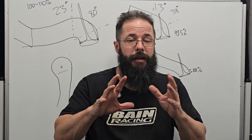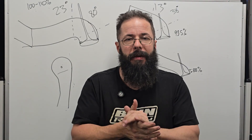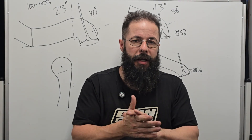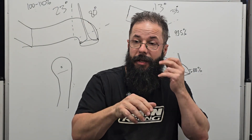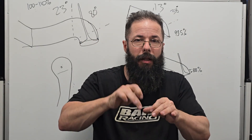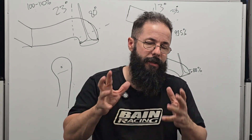In the 2J porting series, we're keeping it really basic, trying to keep it on the smaller side. Most people port too big in the twin cam game — the 26s and similar heads are already very large. People accentuate injector areas and kill the velocity gradient in the port. I tell people: get some plasticine and fill that whole injector area up when you test. With modern injectors, all you need is a tiny little hole in the manifold — adding area just creates loss and robs from the port itself.